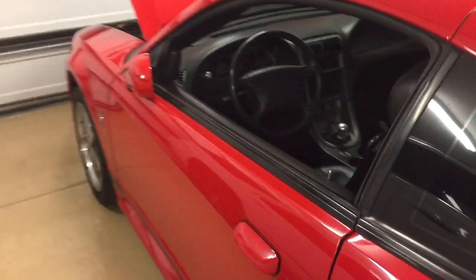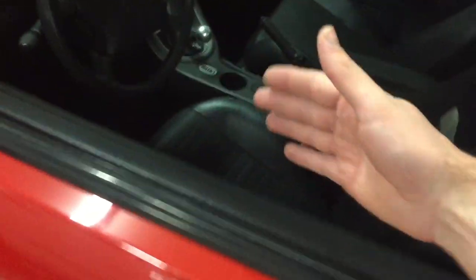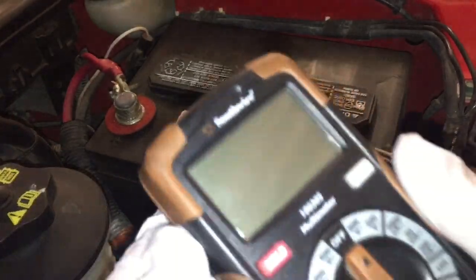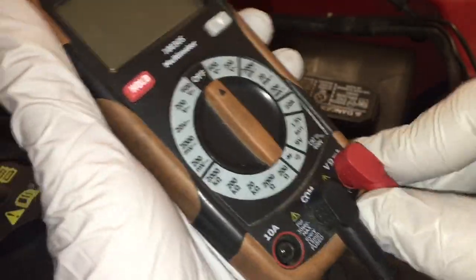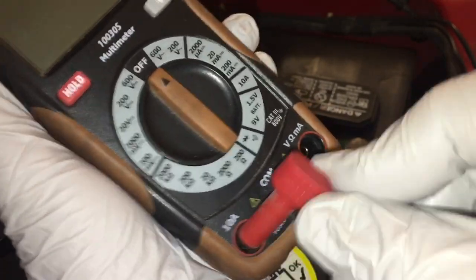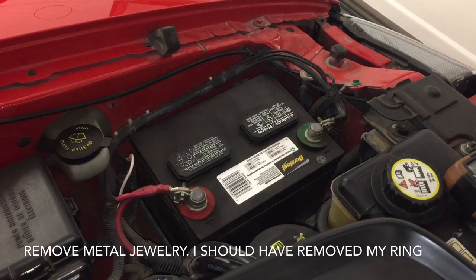Something I like to do is roll the window down so that you'll be able to get in without opening the door. For the next step, we're going to move over to our amp range. We're going to use the bigger amp range — not down in the smaller milliamp range — so we're going to pull the probe out and put it in the 10-amp input.